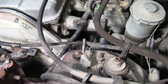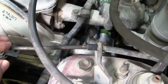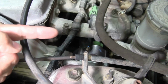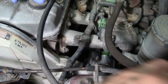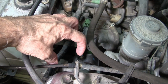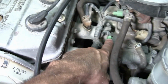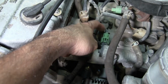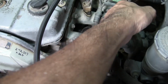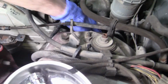Okay, the green plug. I know it's hard to see here. This one, yeah, the green plug on that side, the side facing the car, the firewall. You stick your hand in there and you kind of push down and then just wiggle it. Let me just show them here. It kind of has like this little lever right here, and you got to press down. And then you kind of just wiggle it back that way, and it should come up.